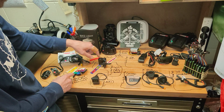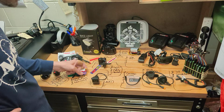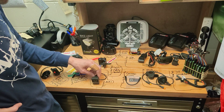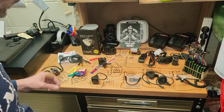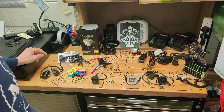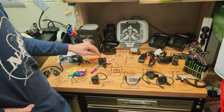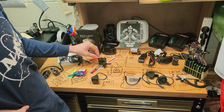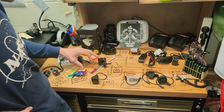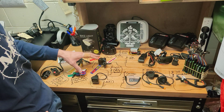The first button can then turn the headlight on or off. Now, if we get the wiring right with the 3-pin connector, that same switch can be used to bypass the NFC, to turn your scooter on and off without needing the NFC. And there's ways and means that one can make this switch just not do any NFC bypassing, but provide that light switching functionality if that's so desired. There's a method of doing that.